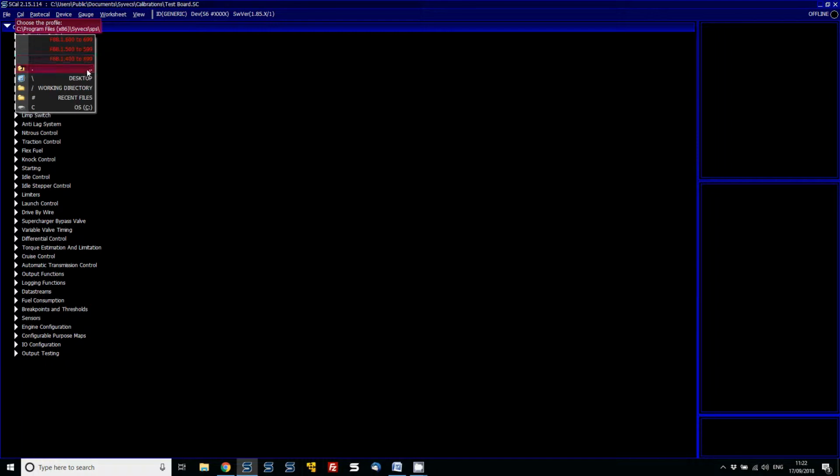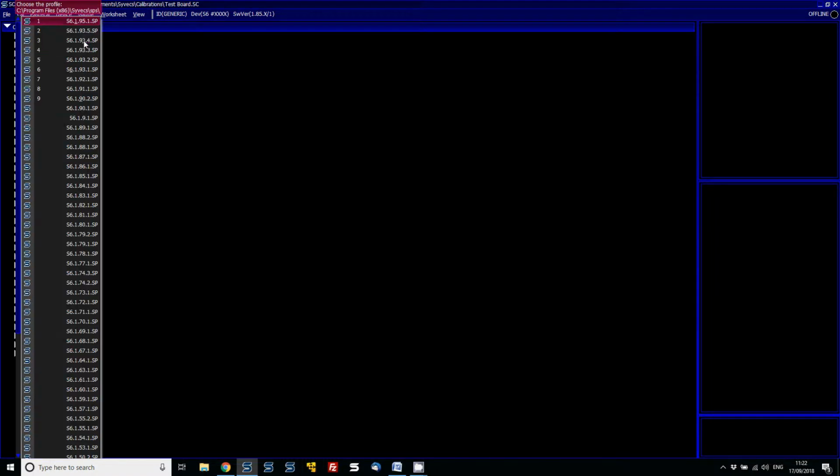The other way of doing it is, if we go back into here and then go onto S6, we can go down to say 1.57, which is really old, and that's going backwards really. What we want to be doing is going forward, moving forward to make sure that we've got the latest versions of everything. So you can do two things, as I said: go back to 1.57 or bring the firmware version on the ECU up to 1.85.